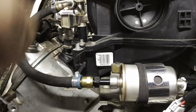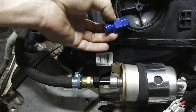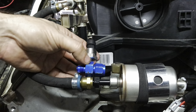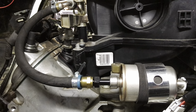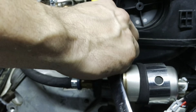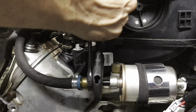I think this is going to be a good location for our fuel pressure sensor. I looked at the wiring and it can kind of tuck in and come right between the fuel rail and the intake manifold and plug in right here. I think it's going to be the best spot. I already checked to make sure there's no pressure in the fuel system because it will just squirt everywhere. And that is the voice of experience talking — I managed to do that earlier.